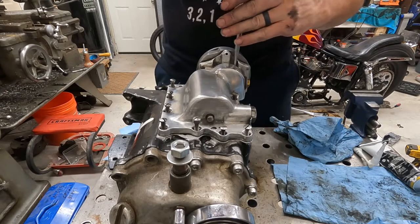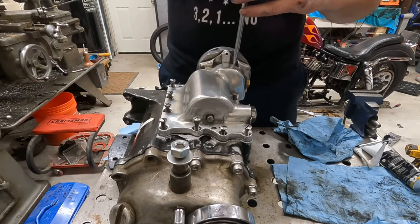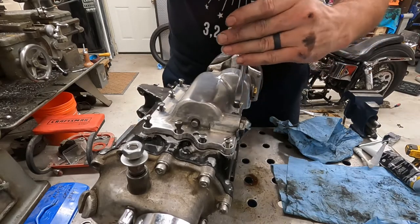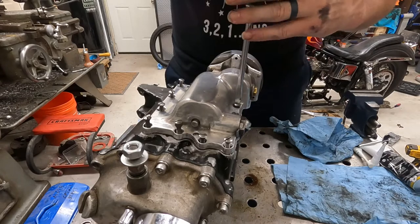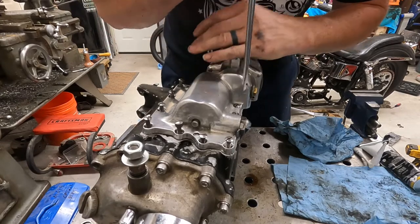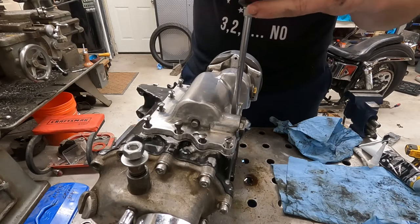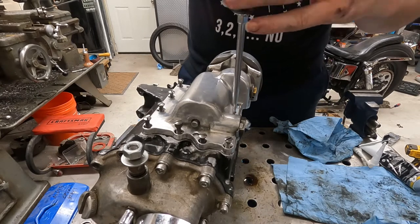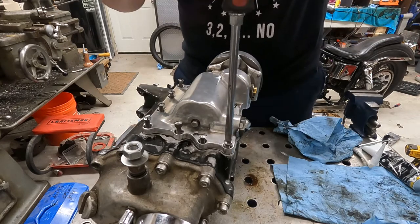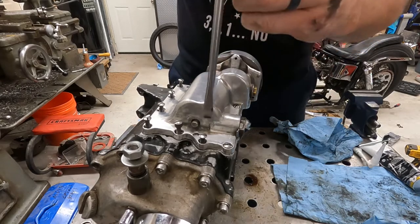One other thing to note: the gear oil inside definitely has a metallic sheen going on with it. So something in there is possibly eating itself. What exactly that is, I have yet to know. Like I said before, third gear we did have to rev match, but with the amount of silver metallic that's going on in this thing, I don't really think that's what's causing it.